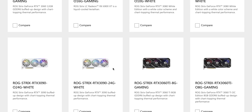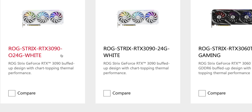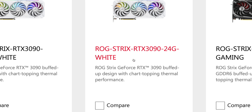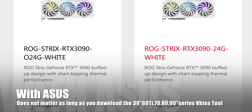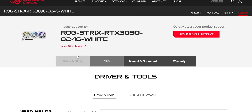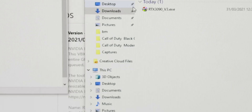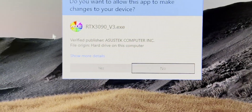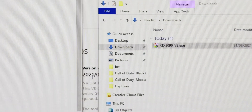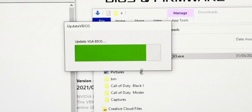Now, this is very important here. I have a 3090, but there are two 3090s — you don't want to flash the wrong one. There's a risk of bricking it. For example, I have the OC model. If I flash this one here, which is just the stock Strix — it doesn't have the higher overclocks — if I flash that firmware onto my overclocked one, I may get reduced clocks, or brick it. But I know I have this model, so make sure you get the exact specific model — go have a look at your box. I'll click on that, go to support, driver utility, then BIOS — and here we have it. I need to download that and run it. ASUS make it easy, and it's going to be different for every manufacturer. But once you've flashed the BIOS, upgraded your motherboard BIOS, and enabled resizable bar, and you have the latest NVIDIA driver, resizable bar will be ready to go.